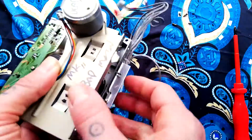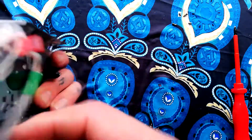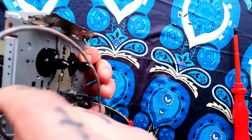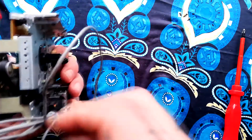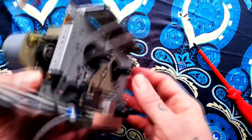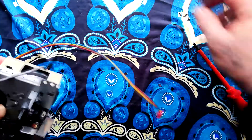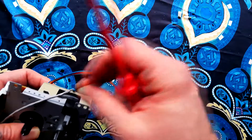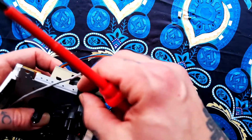These tabs are inside the plates on the front of the transport unit. These black clips are sitting beside the heads and the pinch roller. Of the screws we removed, two have washers and two don't — the ones without washers are the ones that go on the black clips. Once you've got the first one in you can start to work a bit more easily because it's less likely the belt's going to pop off again. So put the other black plastic clip and unwashered screw in first.